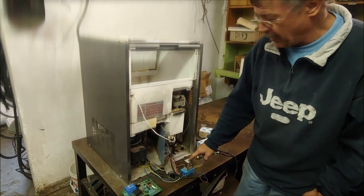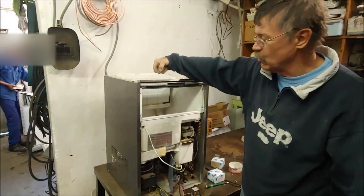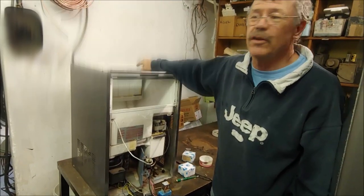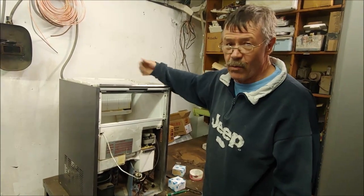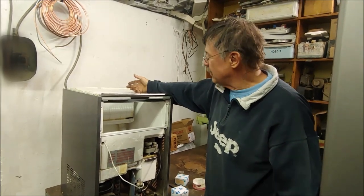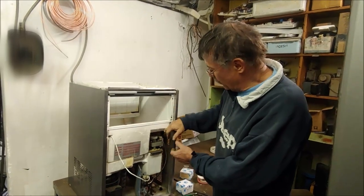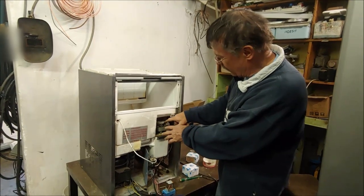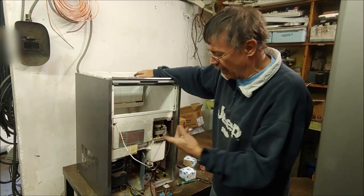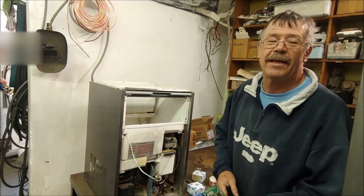That is the thermostat that it cycles on, and this is the relay that activates everything. Now this has got a water pipe connected to the mains that allows water in. So on the mode when it's on hot gas, I put power to the solenoid, so for the whole defrost period it will take water in. You must adjust the tap to get the right amount of water in. Once it goes out of the defrost mode, after dropping the ice cubes, it goes into the running mode, then it switches the solenoid off, and it obviously has enough water for the next cycle. And that's how I disconnect the electronic board and replace it with mechanical parts.